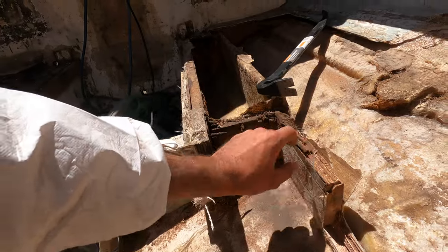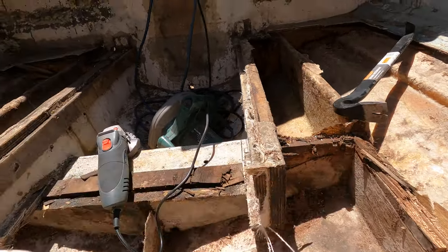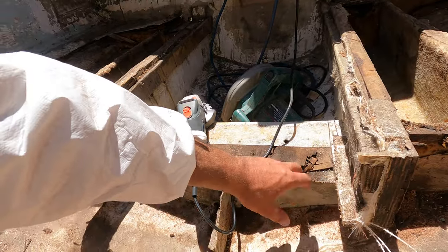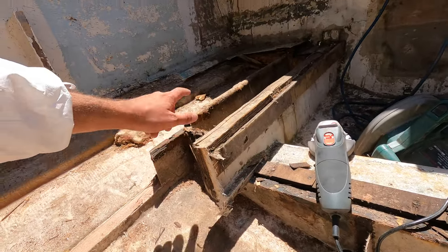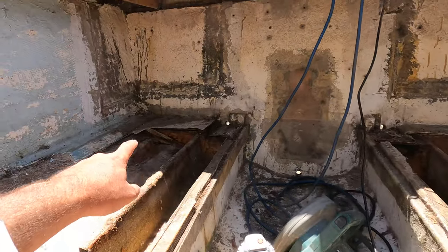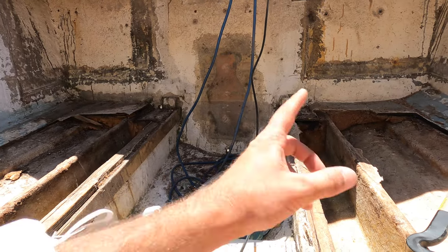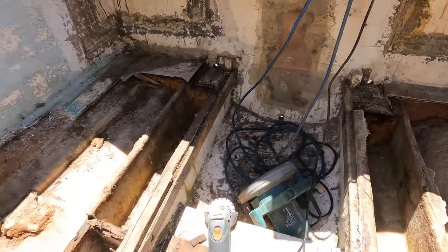Yeah, it looks pretty good. It was just the top — probably 15 to 20mm — that was rotten where the floor was sitting. I reckon we'll go ahead and cut this little piece out and then do each stringer at a time, working our way towards the back of the transom. You can see where I actually stopped cutting the floor there, so it's got another 200mm or so. I'll get rid of the rest of the floor and then finish off the stringer removal.